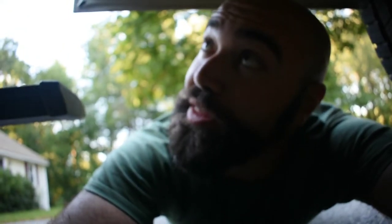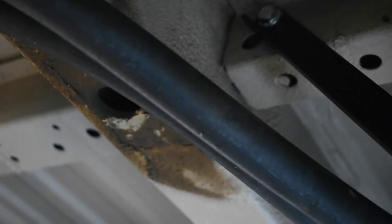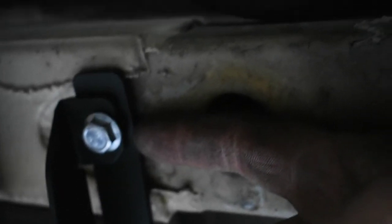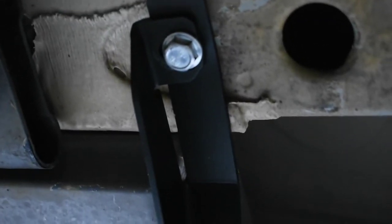The reason, I think, is because if you look at that crossmember where that thing bolts up, right there is a hole, and that's where the hole and the end of the bracket wanted to be. At first I was like, sweet — I don't have to drill the hole, it's already there. But that hole is too big for a nutsert. Here's the front bracket installed. They give you a couple of washers to stack behind the bracket because the sheet metal that the bracket goes over is at two different levels, so you just stick washers in there to fill that gap.